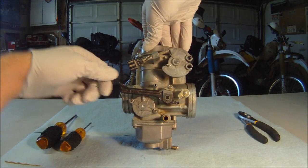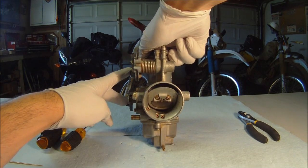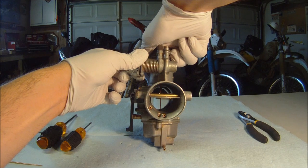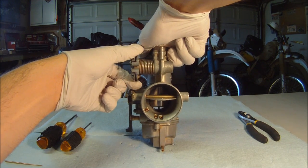Here is the two-level choke for this carburetor. When the choke is off, air is able to flow freely from the air intake to the combustion chamber as much as the throttle valve permits. This is necessary when at operating temperatures because the engine demands a lot of oxygen.